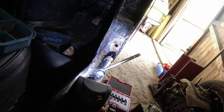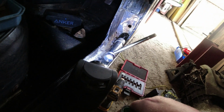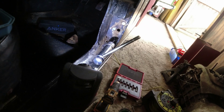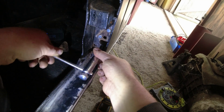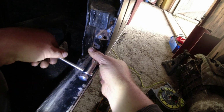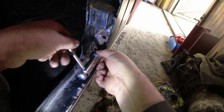Right, cutting that tap, then I can get in there with the finger file and take out the bottom edge of this A-post, tidy everything up, make up a repair section, weld it in. And there we are, we've tapped it. So, recovered the thread in the captive plate without destroying the A-pillar. That was a faff though.